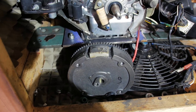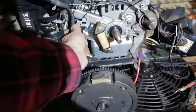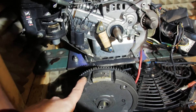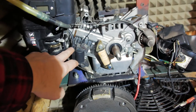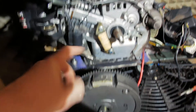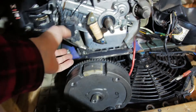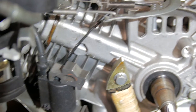Unfortunately what happened was I didn't leave enough of a gap between the coil and the flywheel, and somehow — maybe due to thermal expansion or something — the coil ended up catching the magnetic trigger plate, and it ripped the mounting point off of the mounting post for the coil clean off.